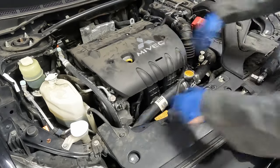The fruit of our labor — car's back up and running. I was excited to get this starter motor out without removing the manifold, but apparently you can't. Now I didn't have to remove the manifold completely, but it does have to be disassembled enough to pull it away from the engine. Maybe your Lancer is different, but this Lancer didn't cooperate without pulling that manifold off. So you live and learn. This is a tough job but not impossible. Book time was a little over an hour — in reality it took me about three hours to do this whole job. So not too bad but more work than anticipated. If you have any questions, comment down below. Thanks for watching. Like, subscribe. See you on the next one.